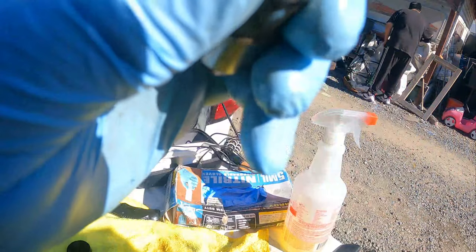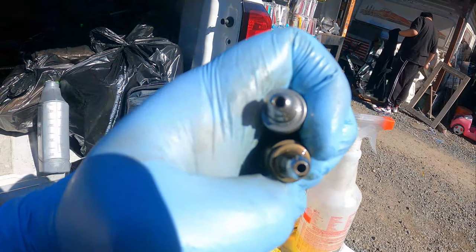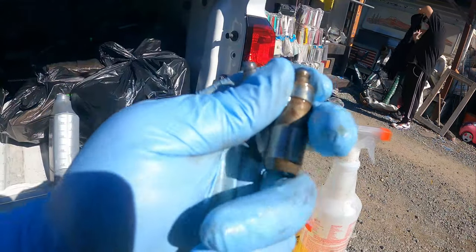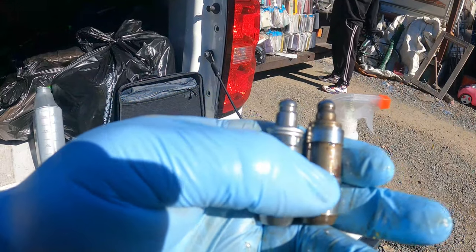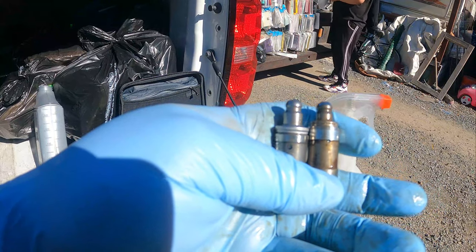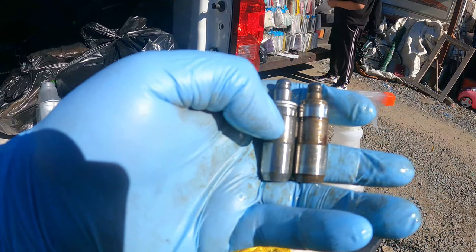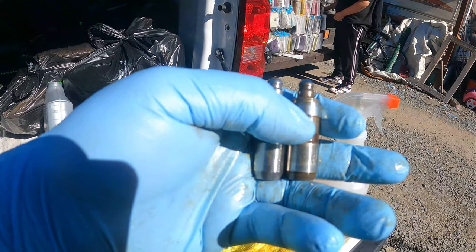Because they're usually the revised ones, the hole isn't that big. I'm going to see if I can find a picture of the original 7-bolt lifters so we can compare them. Those are one of the big differences — this little circle right here where it releases some of the oil looks a lot bigger and it's positioned a little bit lower. Maybe that helps it flow more oil in and out compared to this one.